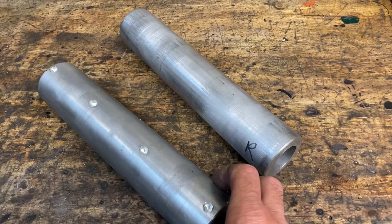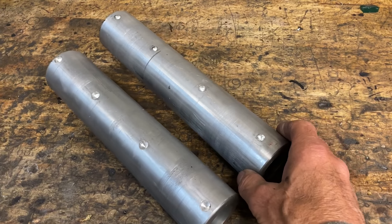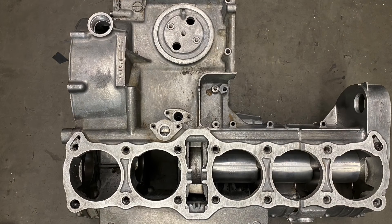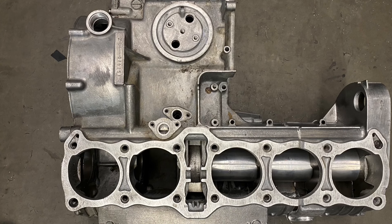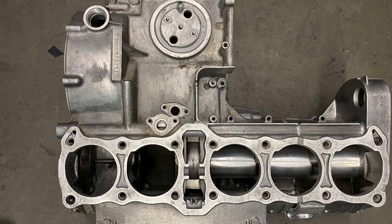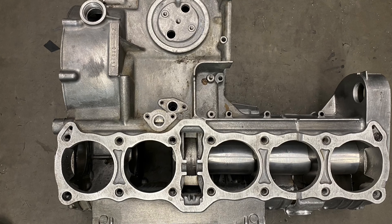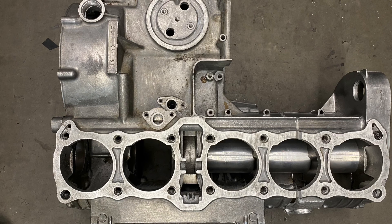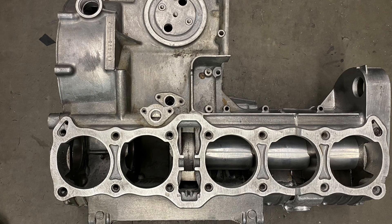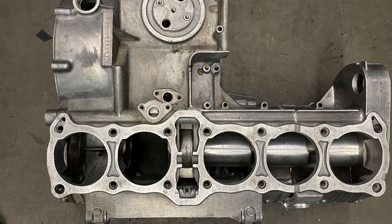To hold everything in line for welding I've made up these two mandrels, which have holes in them to miss the little pegs in the main bearings on the Z1 engine. Here you can see the central crankcase with the mandrels clamped into the main bearings and the left-hand extra piece clamped in place ready for welding. At this point it looks like a pretty nice five-cylinder — I almost left it as a five, but I decided to carry on and make it a six because that's more central and more even, and I said it was going to be a Super 6; otherwise it'd be a Super 5 and that wouldn't sound right.